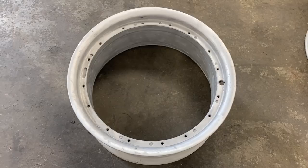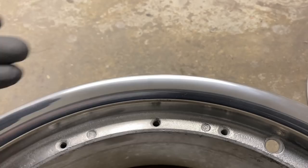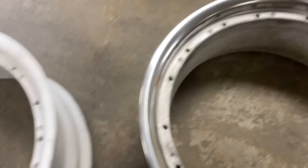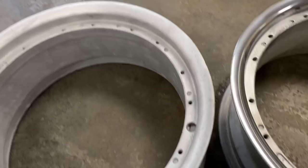I've already done some so I can show you — this one is fresh from being stripped, and then after about an hour's sanding you end up with this. So we've got a mirror polished lip — you can see the reflection in it. They're not by any means absolutely spot on, but that looks a lot better. We've gone around the lip as well so when the tyre's on it'll look right. We've done three — we've got the fourth one to do which is the one with the crack, but we'll continue, get it sanded and polished up, then when we take it for welding we'll just clean and sand that little area back.